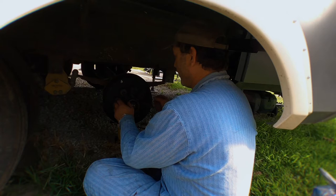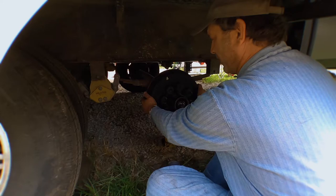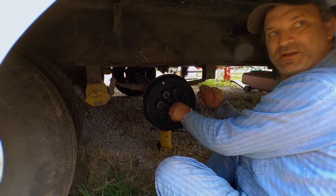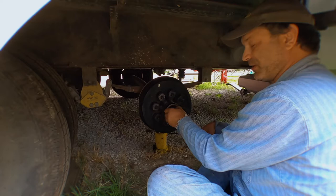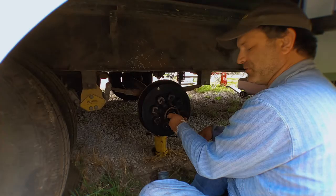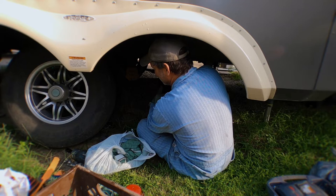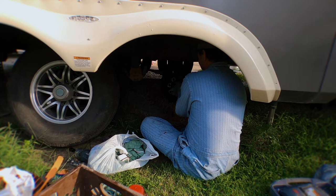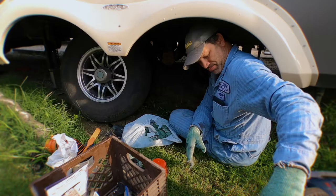The way I was taught: whenever you set your hub, there's no play in this hub, so it's tight. You want just barely any play — it's not tight tight. I mean, it's not much, you can barely tell it but you can feel it. You won't notice it whenever you're driving on the road. Those tires look good. It's like we got the only set of Westlakes that haven't had issues. It could be that they're G-rated — those specific tires are actually not bad, but it's the lighter weight ones on smaller trailers that blow.